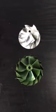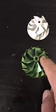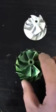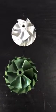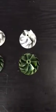Because we've been copied by some of the German companies. Golf 7 GTI standard compressor wheel — there's the upgraded one. Inducer blades — once again seven blades, also has an extended tip, and the tip heights are also modified. You're looking at approximately 44 millimeter inducer on this wheel. The exducer we'll keep secret for now, but those are the two options we have for the Golf 7 GTI.